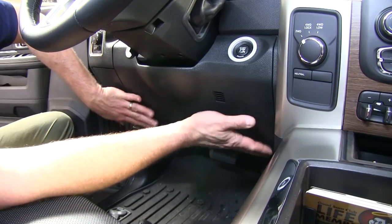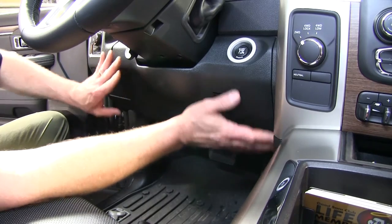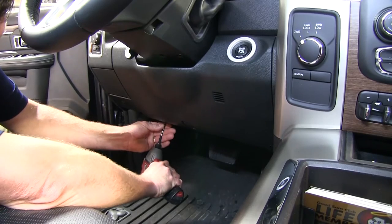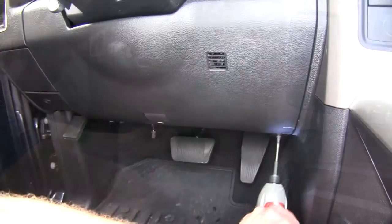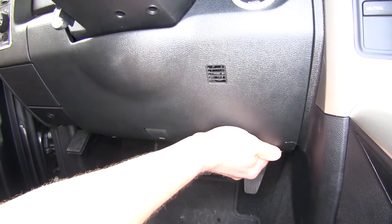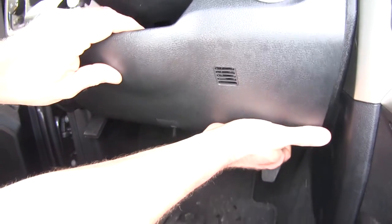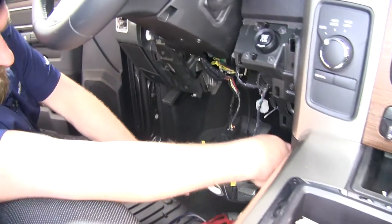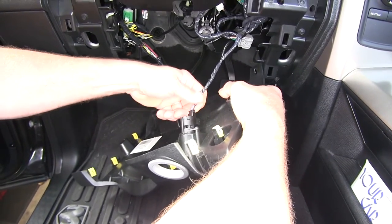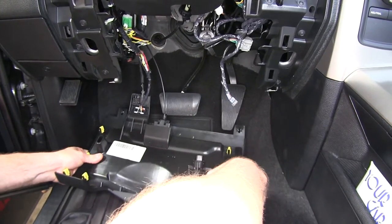To begin, we're going to go ahead and drop down this panel. For installation purposes it probably won't be necessary, but we're pulling it down so we can show you exactly where your harness is going to be located. There are two Phillips screws. Once you have those two screws out, you just pull out at the bottom, slip it forward, and drop it out of place. Then unplug the plug that goes to the fan built into the dash — just squeeze in on the little tab and release it to give us a bit more room.